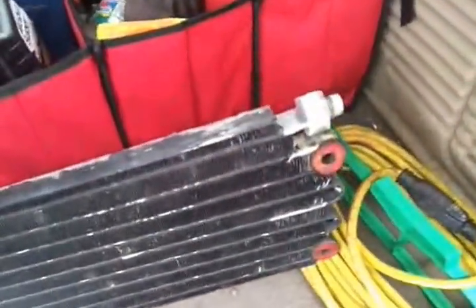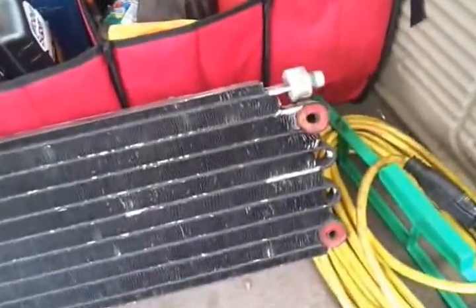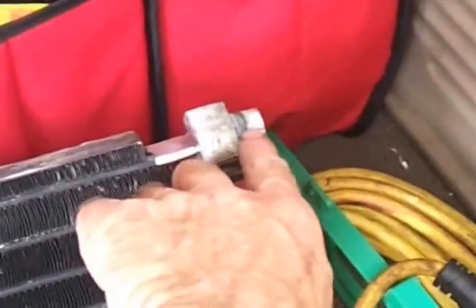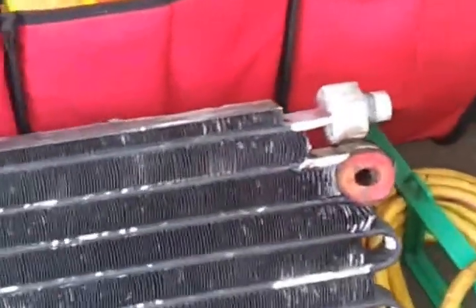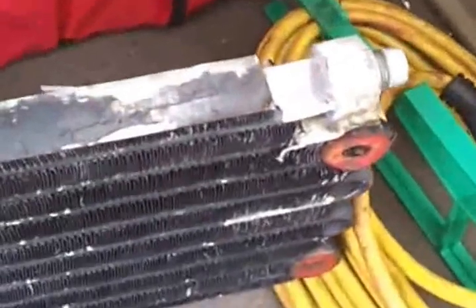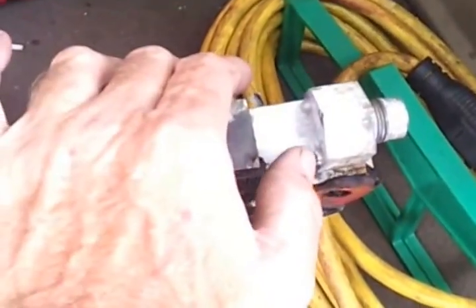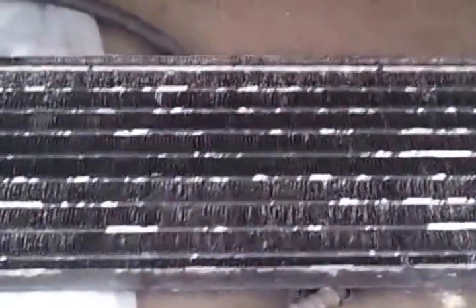I took this to the radiator shop, and they did decide they wanted to take that line loose. They heated that nut up right there. If it'll focus, my camera will focus in. And what happened right here where you see the shiny part, that is aluminum where it galled, minus threads. So I've really got no choice now but to replace this core, and they are expensive. But right here you can see the crack where it ruptured. Anyway, once I get this condenser situation squared away and recharged, that will finish my work up under the hood. Thanks for watching. Bye.